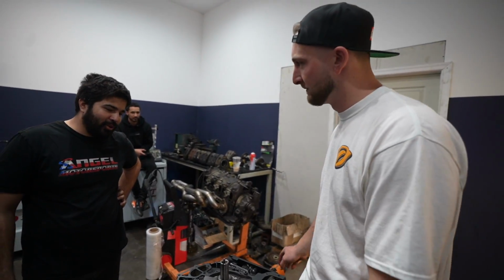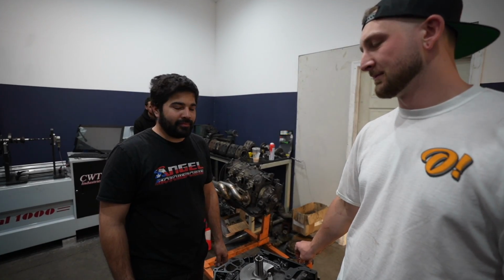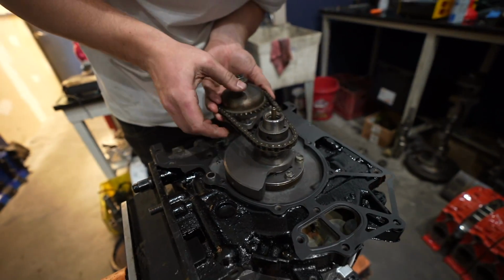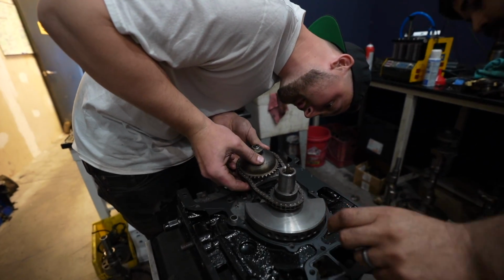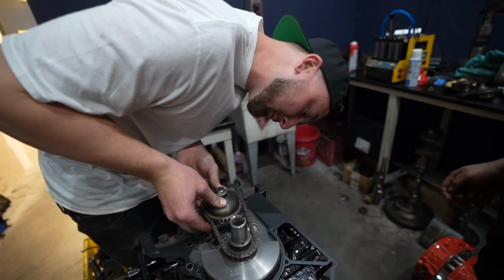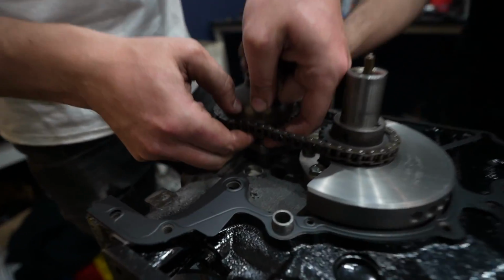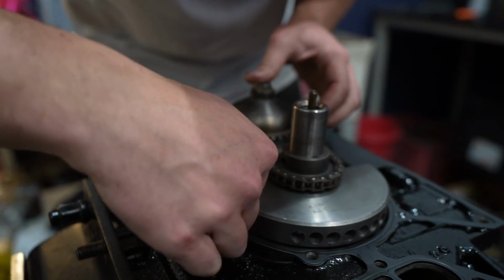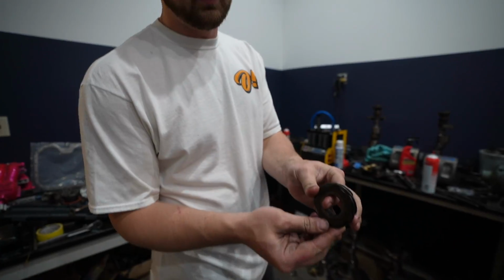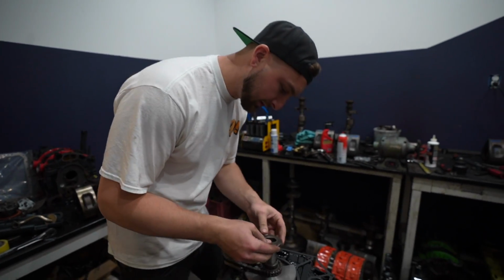So what's next? The oil pump. It's in the parts right now, so as soon as it pops out. Perfect. Here, of course, we put a lot of oil inside the oil pump gear, so it's not gonna do a dry run when we first start it. And then we have the drive gear for our crank angle sensor, I guess you call it on this thing.